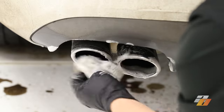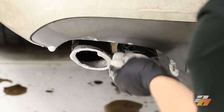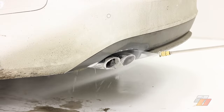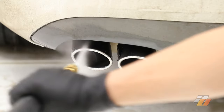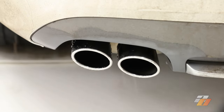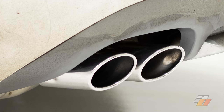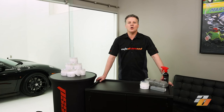Get the entire exhaust tip with the polishing soap, not just the buildup on the edge. Rinse the soap away and you'll see the difference. If you're dealing with heavy buildup where the polishing sponge is ineffective, you can abandon the polishing sponge in favor of some fine steel wool. Put the polishing soap on the steel wool and work the exhaust tip with that.